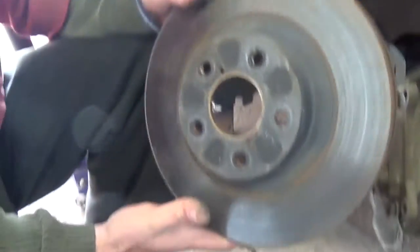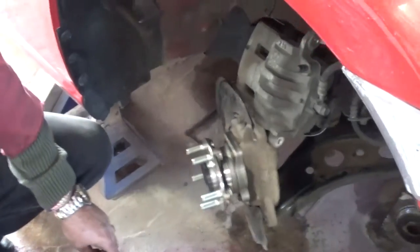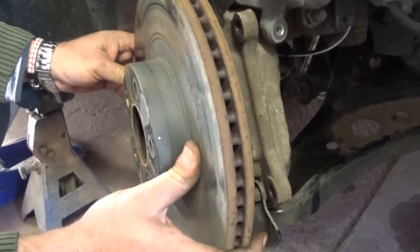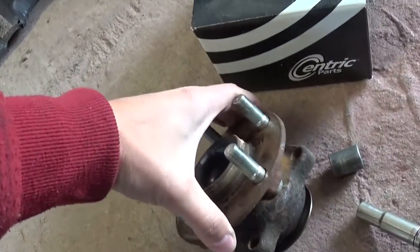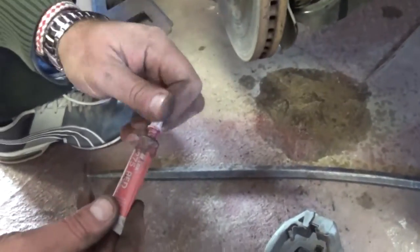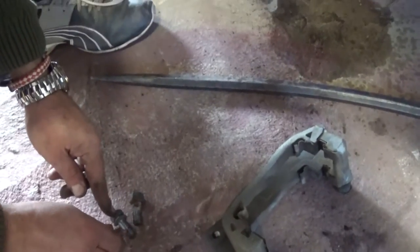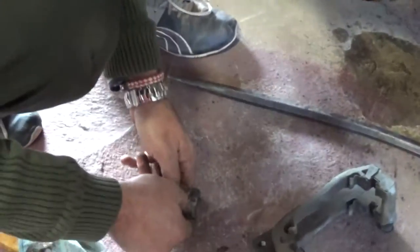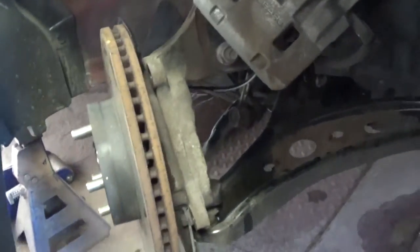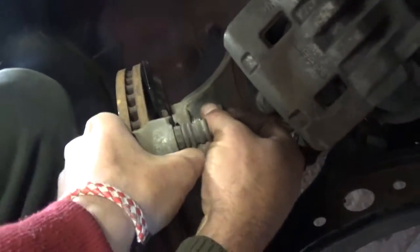That's the rotor and that's how you remove it. We're going to put things together and show you how to install the brake pads. We put in the new hub - the old one was causing problems, it was really noisy. We replaced it for only about 80 to 90 bucks online with free shipping. Now we need to apply some thread lock on the two bolts for the brake mount - get those tight because working on the brake system is no joke. You need to do everything the right way.